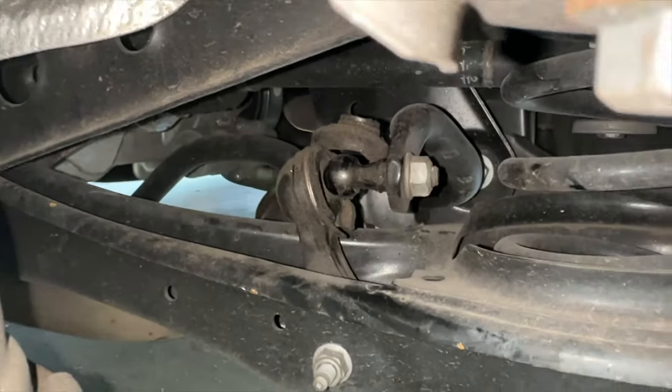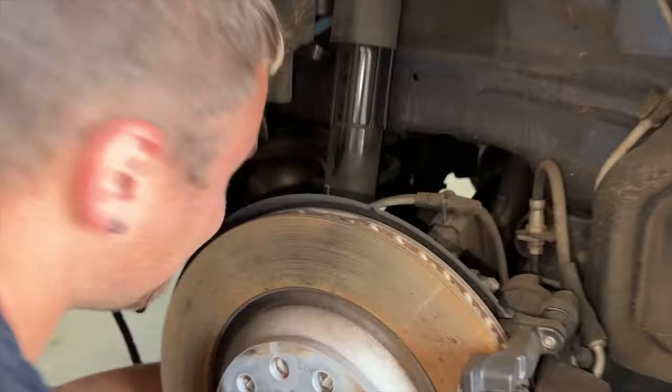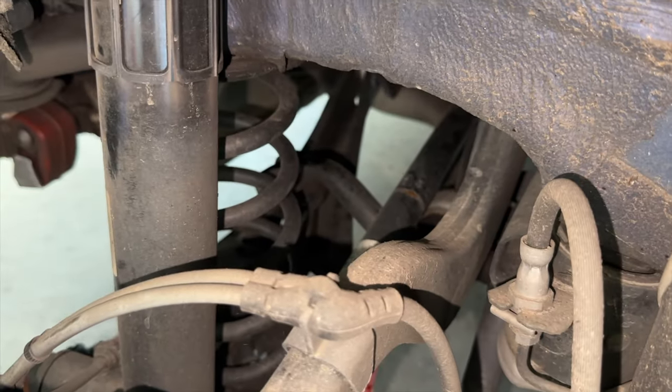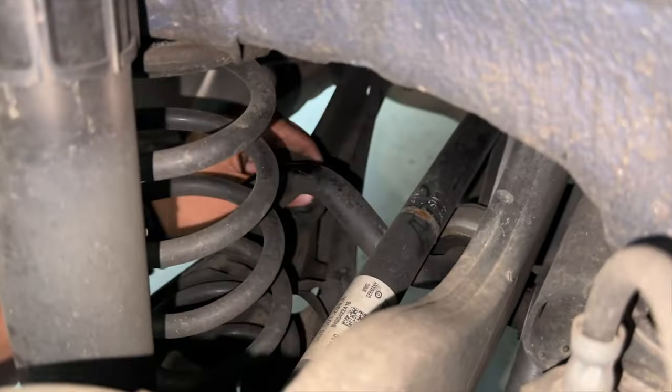With the interior of the car finally back to stock OEM condition, it's time to start working on the rear end. The first thing we're going to do is install a new sway bar end link because the one I found seems to be broken. This only ran me about $12 online and it looks pretty straightforward to install. In order to access the rear sway bar end link, I needed to take off the wheel. There are only two bolts that need to come off, but it's not that simple — the bottom bolt you need to hold from one side with a socket and the other side with a wrench to stop it from spinning.